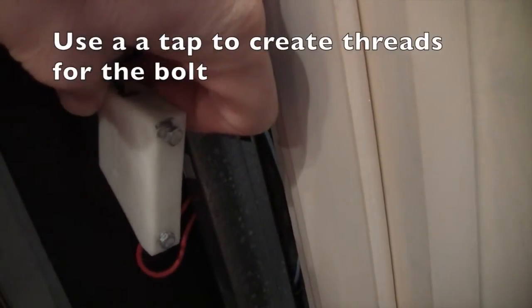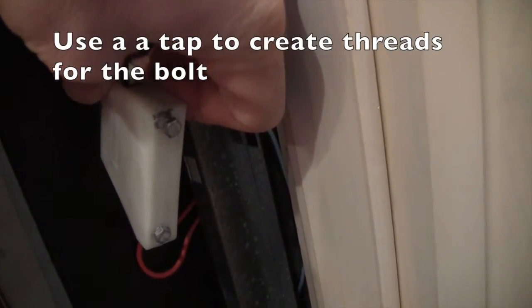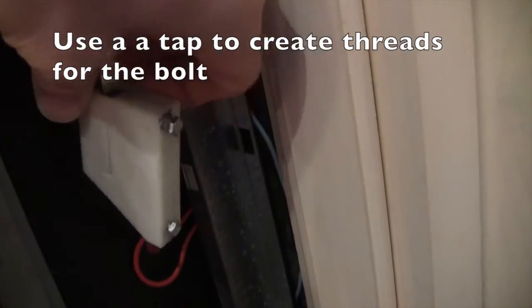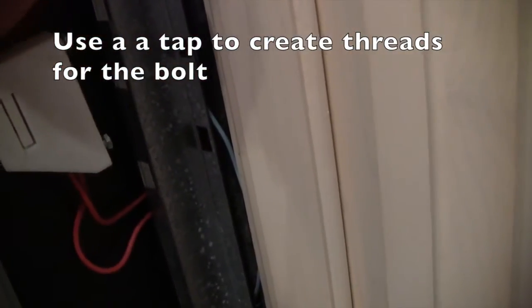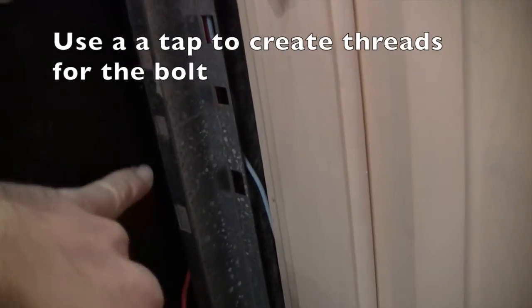What you can do — it's got some little features that break off where these bolts are. If you take a drill, drill a hole out, and throw a bolt in there, it will allow those bolt heads to catch in these two holes here and here. And you can get your dishwasher functioning again.